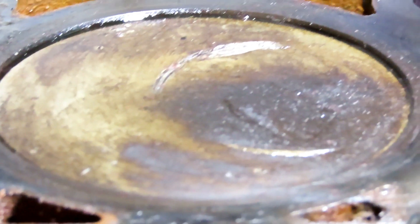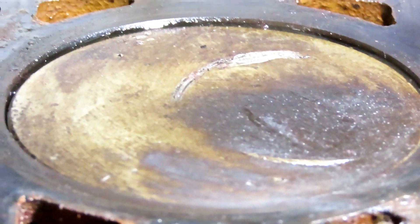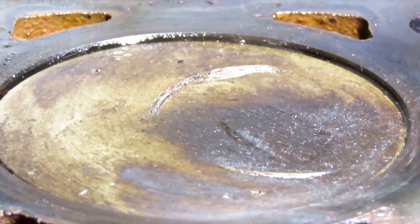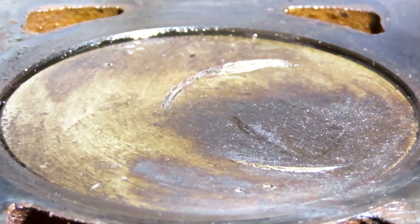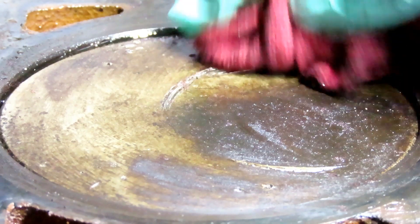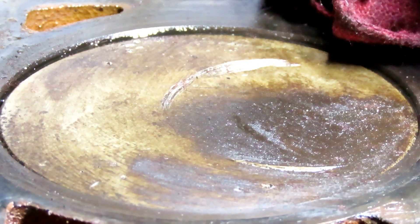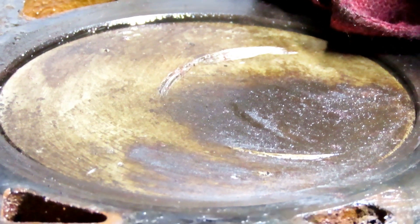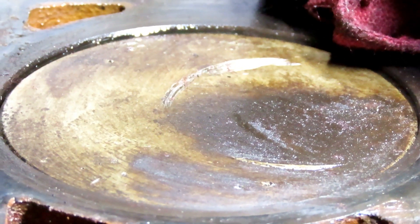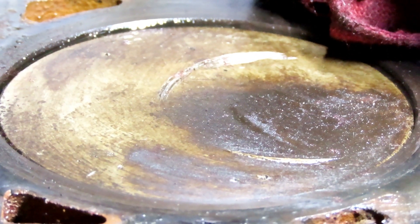What would I do? You rebuild it. I don't know - would I take the engine out and rebuild it, or would I take a chance and clean it out, clean the top of the piston, get two new heads? It all depends on how it ran, and I don't know. This thing looks like it's severely overheated, amongst other things.